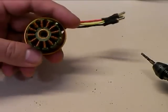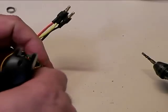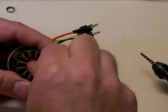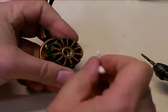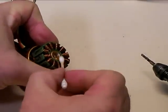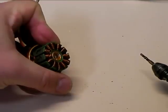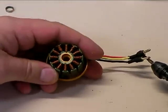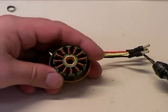Then take a little can of compressed air and blow out the excess, then clean it out with a Q-tip. Now you can see a little tiny mark right there where the Dremel tool just nicked the aluminum, but the part came out nice and clean.